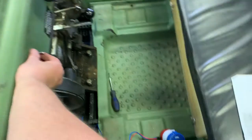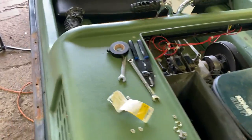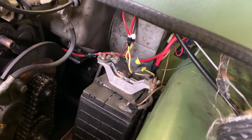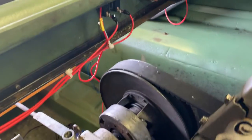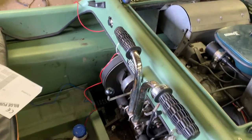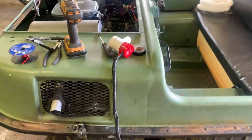I'll show you how it's wired and then do the back one and figure out where to mount them. I flipped the switch and had no power, so I decided to haul everything apart and just do it properly — I'm having a bit of a slow day. I ran two new inline fuses and got the wires ran over — two wires, one for each switch. I got them connected and now coming out I've got my two wires. I need to connect the blue to ground and this one is going to feed the rear bilge pump.